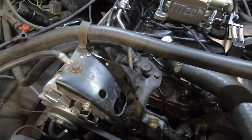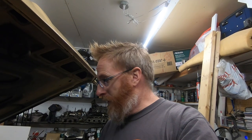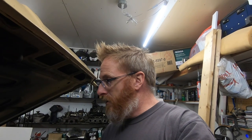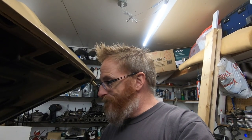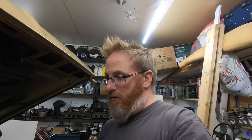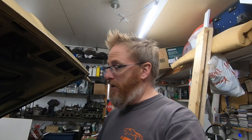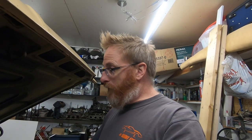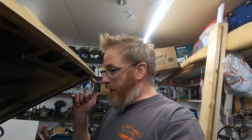So we've got to go out to the shop and get that. And like I said, other than the constant power to the battery, that's the last thing we have to hook up here. Then we can get the truck jacked up in the air, up on the cribbing, drop the fuel tank, unplug everything, run the fuel lines. I feel like I'm forgetting something, but I don't. Oh, the air fuel ratio sensor, which we've got to put in. But we've got to get the truck jacked up for that as well. So I'm going to run out to the shop, we're going to grab that tap, and we'll get that done. In the meantime, I'm going to drain the antifreeze out so that we have something to tap into without making too much of a mess. And then we should be done up here.